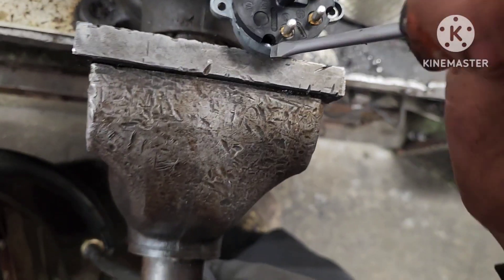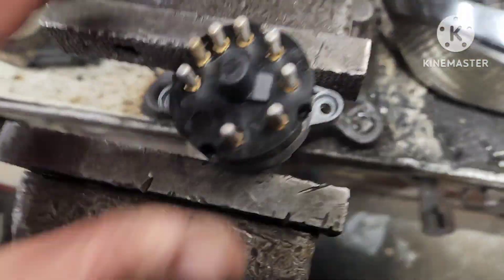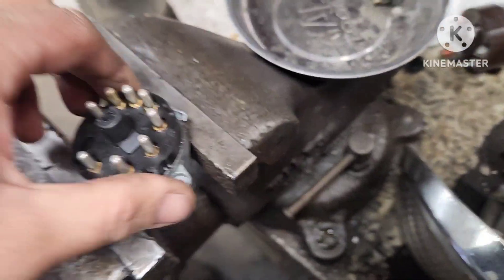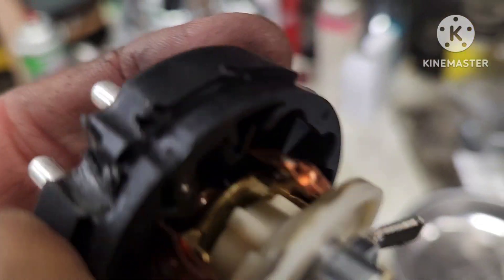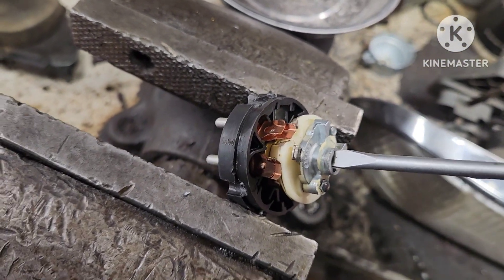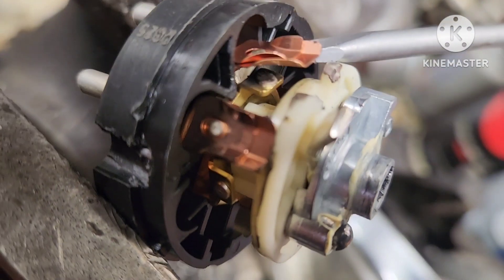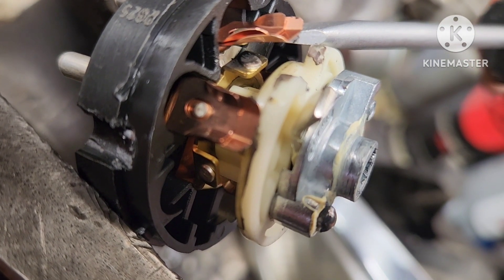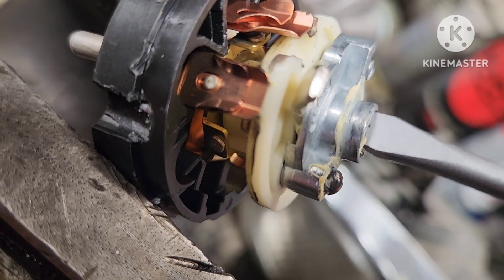Now we got the old switch here on the bench. It has these little bent-in retaining tabs — so if you're going to try to rebuild or fix it, it would be kind of hard because when I was prying on this, these metal things just broke. We popped it out and now we have the switch as one solid piece. What's actually in there are these little contacts that open and close — they look like points on an old distributor. They've gotten hard, corroded, and pitted over time. You can see this one spot — there's a lot of black and tarnished areas. The other pins look like copper and aren't as tarnished or burnt off as this one. I think this was our issue, and when I put the new one in it seemed to work. Thanks for watching!